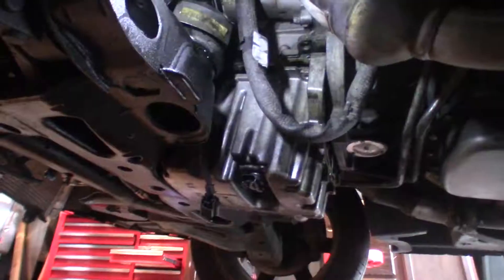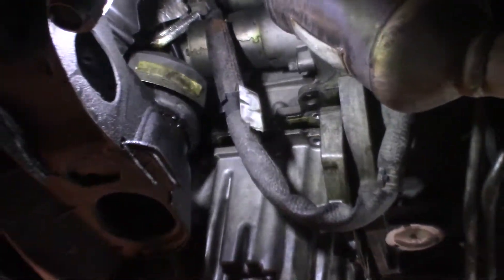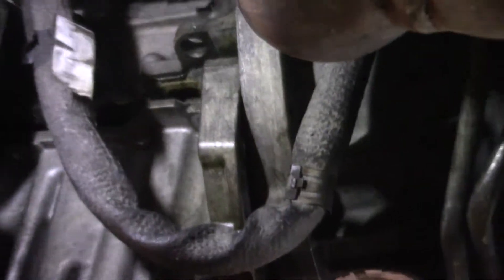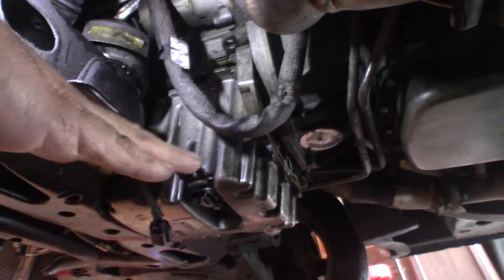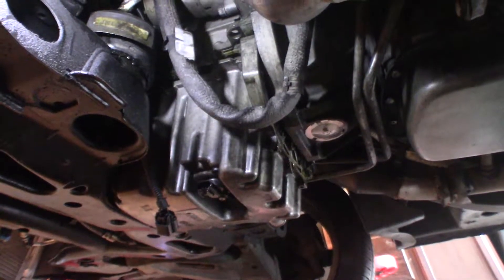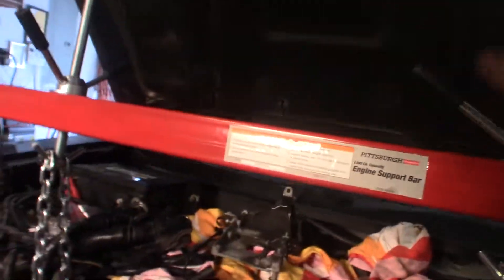I got the bolt out. Now we're going to need to jack this motor up some — I'll show you what's going on on the bottom side. We're looking up from the driver's side and you can see the side of the pan starting to come loose, but it's bumping on the front of the transmission. So we're going to need to lift the motor up more, and that'll create more room for the pan to lever its way out. I think another couple of inches should give us enough clearance to have the pan fall out of there. We're going to rotate these and keep jacking the motor up evenly.